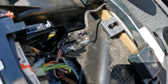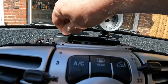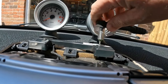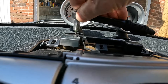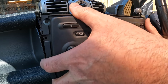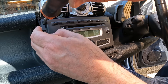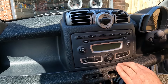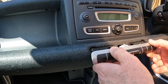With the connector securely fitted into its place and the wiring correctly routed, the two pods can now be screwed into position. These are T10s - we're only tightening up plastic onto plastic so we don't need to go crazy, just firm. Let's get the radio back in. Time to refit the trim and refit the T25, then clip the switch panel back in.